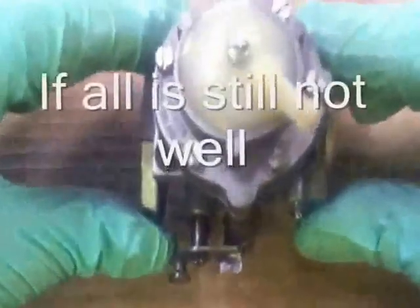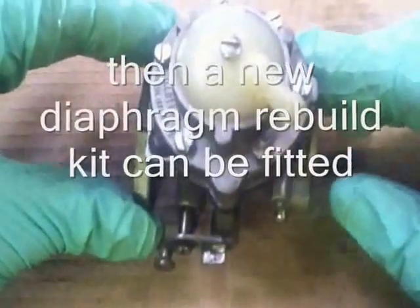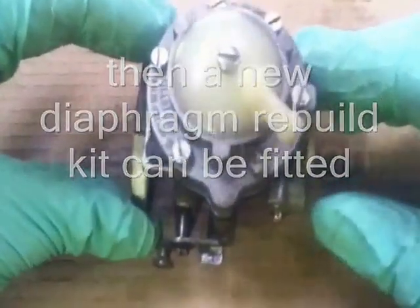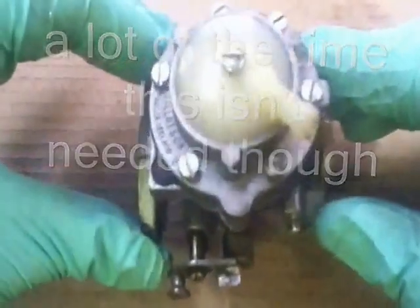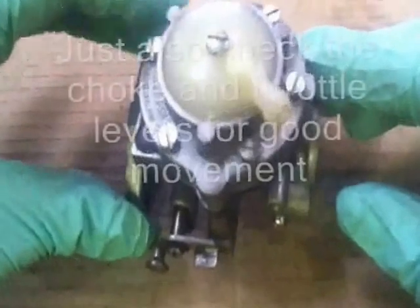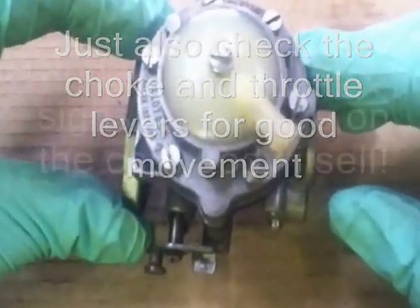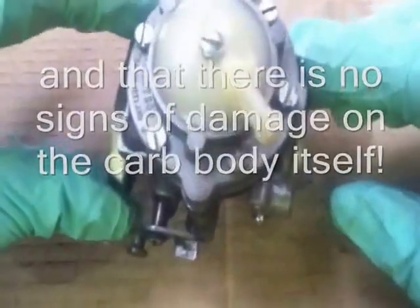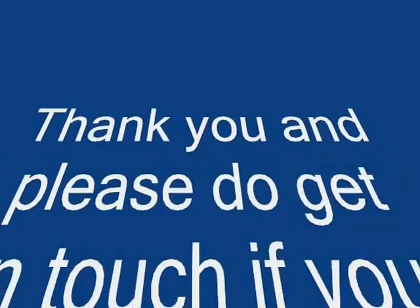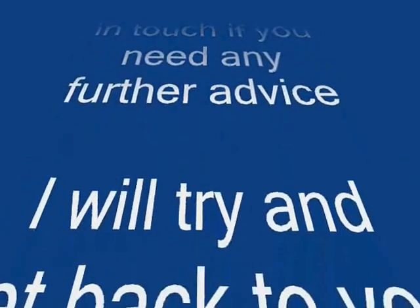If you do find you're still having problems, then yes, you could seek out somebody who's got a sonic cleaner and ask them to sonic clean it, and try some carburetor spray. But you'll tend to find that if you've cleaned it right and used an airline and some wire brush bristles, you should be okay. But as I say, there's always the option of the others. Are you ready? Look at that. See you in the next video - see you soon, bye.